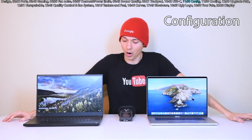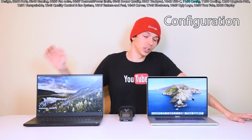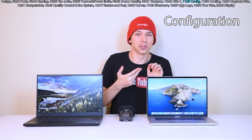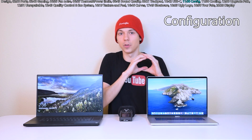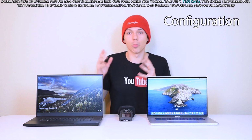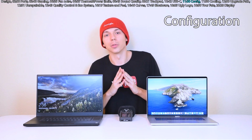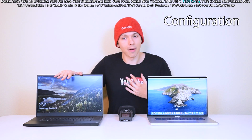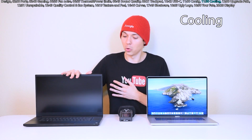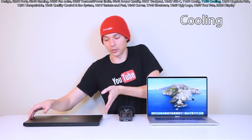When it comes to raw performance, you can get a 6-core or 8-core on here, but the 8-core is going to thermal throttle, power limit throttle. It gets too hot, the power brick can't feed it enough power, so it doesn't even run at the right performance level. But it's still great performance, it's just you're not getting the full performance, right? With this, you have the same problem, but not as much. You're getting about 30% more performance with the same specifications on this, because the cooling is really impressive.